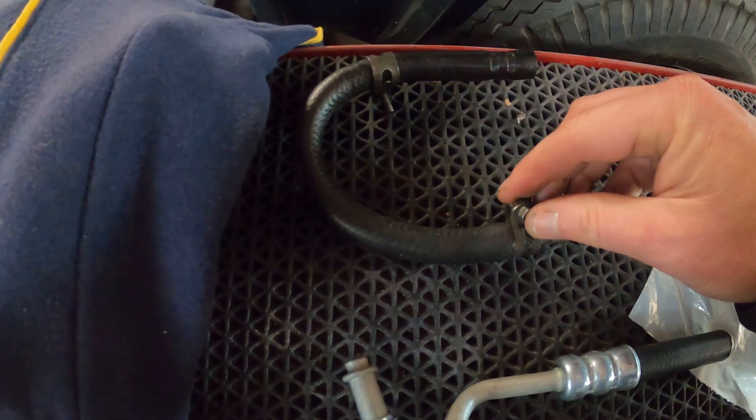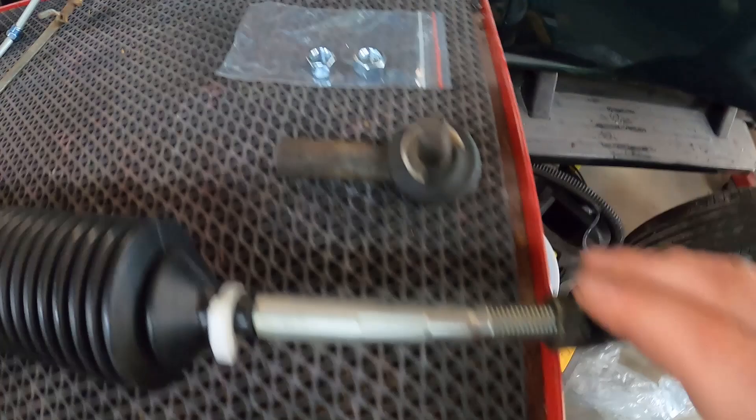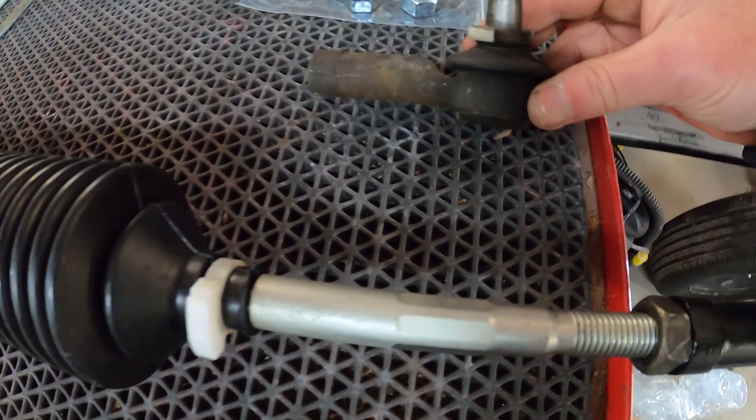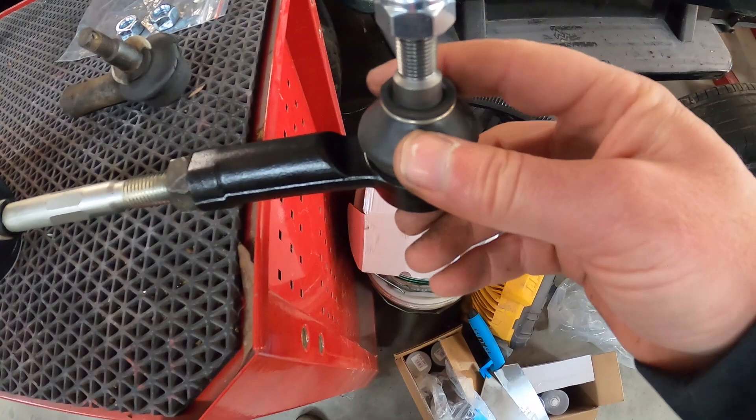Moving up to the end of the power steering rack here, you've obviously got your alignment nut — we've got some brand new ones, so we'll chuck those on. That's our old tie rod end from the VN — look at it, the bushing's all been better days. The side of the shell's cracked and you can't reuse these. So, dear old Rare Spares hit us up with a brand new set of tie rod ends, brand new bushings and a brand new captive nut. That'll be the go.